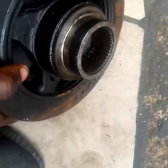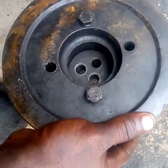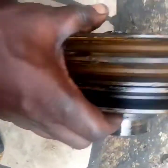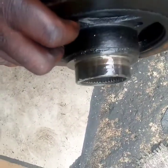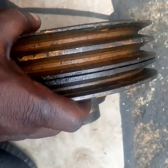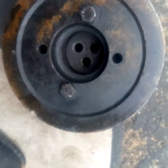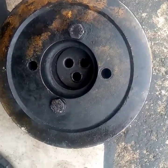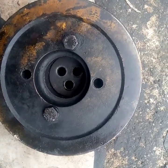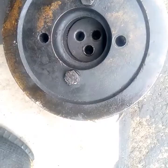Remember, your crankshaft travels up and down, and this vibration can cause havoc to your crankshaft. That is why this damper is made — it will absorb the vibration so that your crankshaft's up-and-down vibration is managed. This pulley absorbs it and helps the crankshaft convert it to heat energy. That is why some call it a balancer, because it helps to balance your engine and your crankshaft.